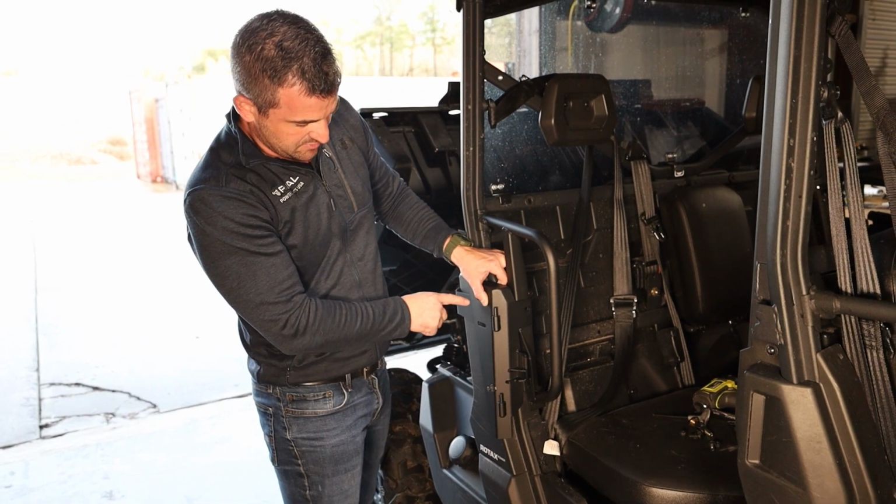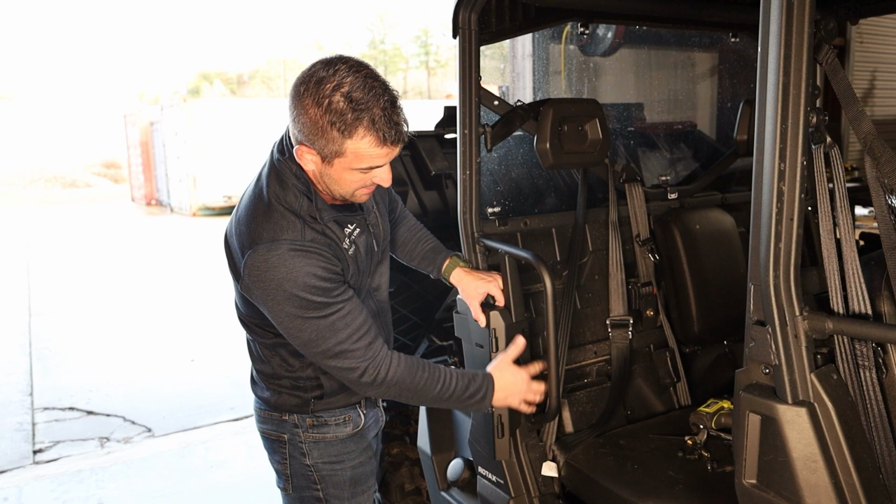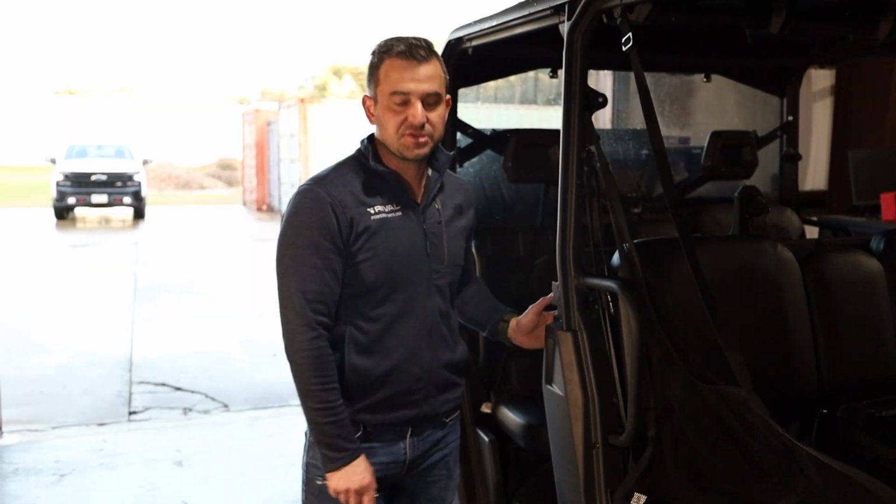And then just start that off thread, and then go back, and we've got 2 8mm holes here that are on welded nuts, and then 2 8mm here where you'll need washers and a nut from behind. Okay, so we put the door pin on here.